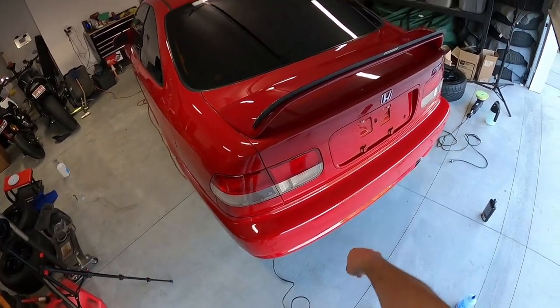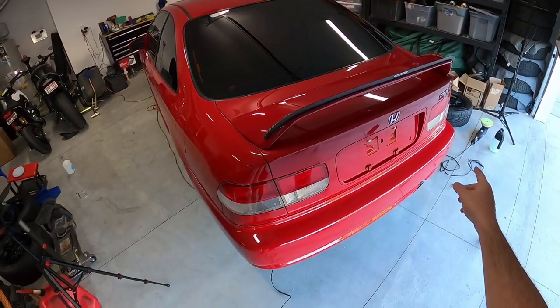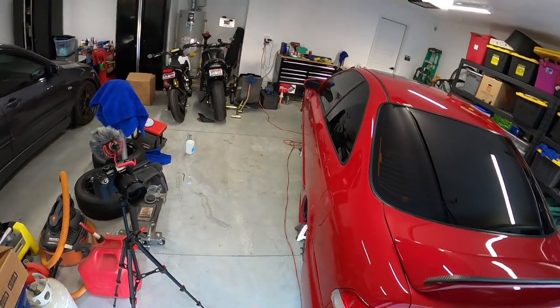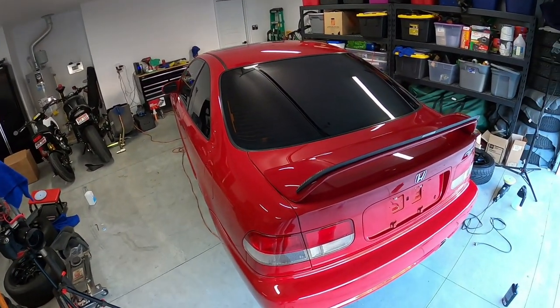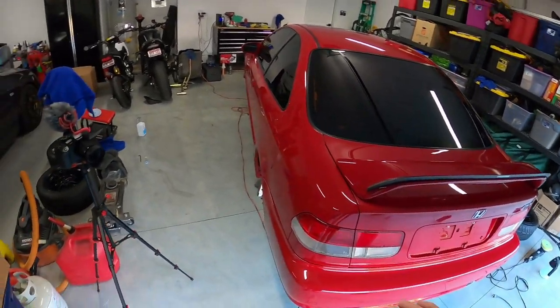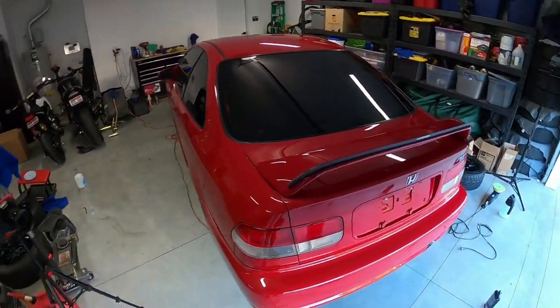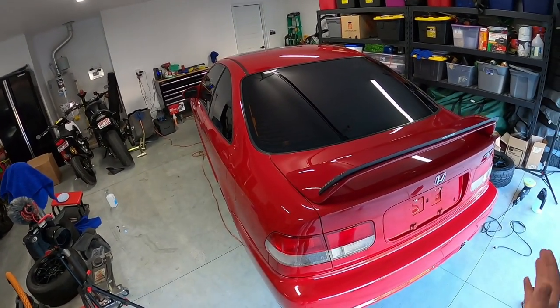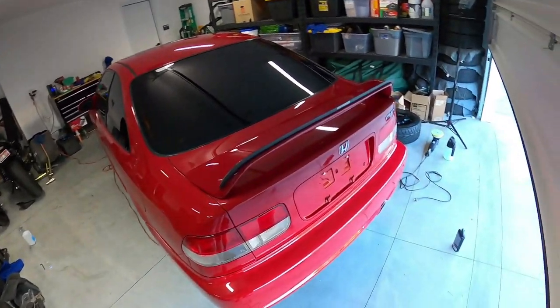From there, rear bumper with the LHR15, the Rupes, knock that out since it's big enough. And then I'm gonna zip through the side skirts with this little guy. And then from there, I'm just gonna kind of finesse the sides one more time, mainly for the fact that that resprayed door had super hard clear coat. So when I wet sanded it, I had to spend a little bit more time on it. So I really wanna refine that.